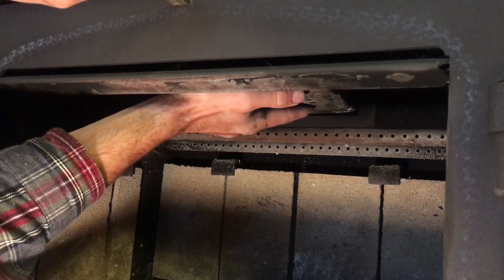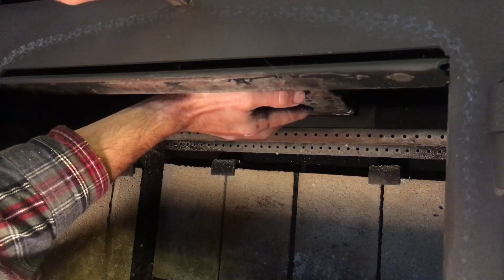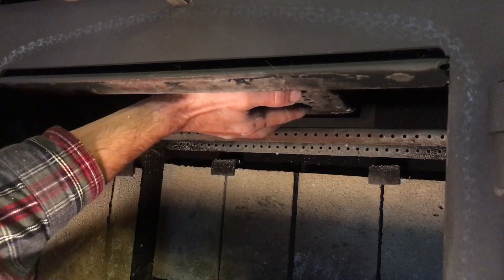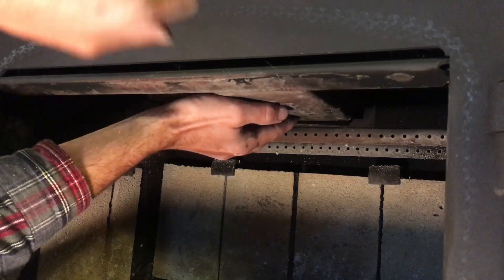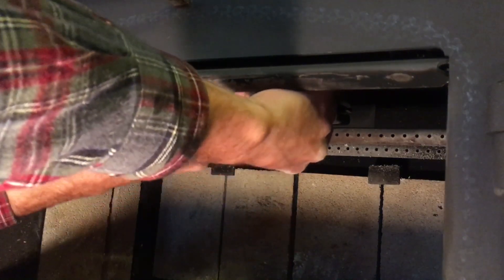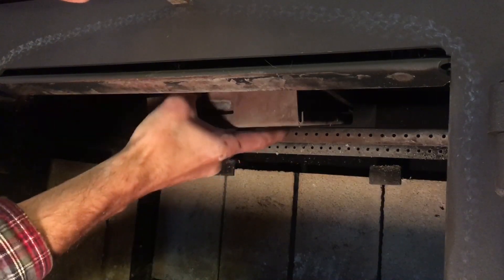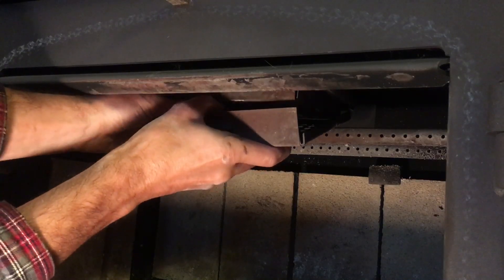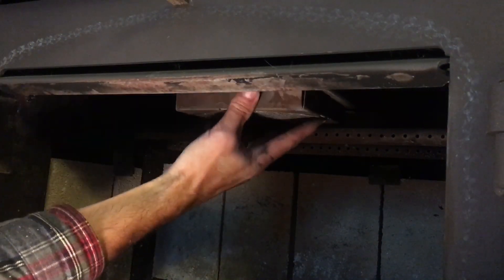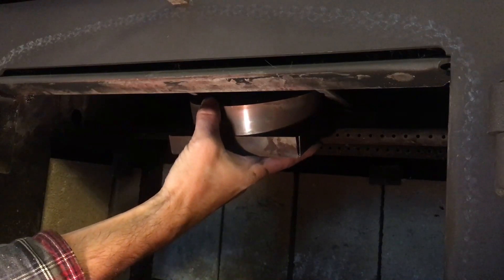What I just did was slide it forward — I grabbed in these holes and then pushed the mechanism back. My hand is holding this assembly, so you want to have your hand under it; it is a little bit heavy when it goes to drop down. The combustor is up on top of this. I'm going to slide that forward. This is tricky to fit out with that secondary tube in there, so I'm going to hold the combustor from inside here so that I can slip out this cover. The combustor is in a retainer right here — slide it all the way forward and then you can slip it out.